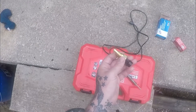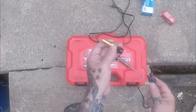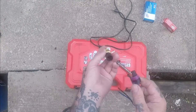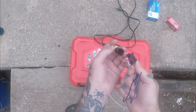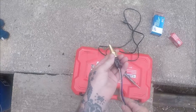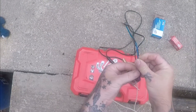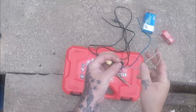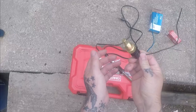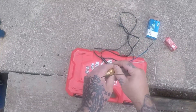It's too big to go into the LS holes — you want one that'll fit in the hole so it'll work. You can tell the plug goes in just like so, fits perfect, great replacement. Now we can have the computer hooked up to it with two wires — one goes to the computer and one goes to the temperature gauge. We'll figure that out in this video.